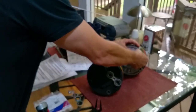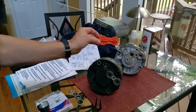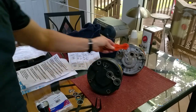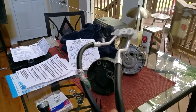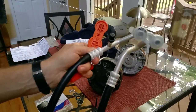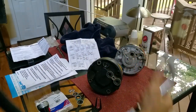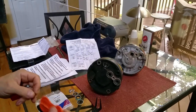Anytime you are about to do air-conditioning component replacements, make sure you keep them sealed until you're ready to actually do the work. Anytime you buy something AC-related — even hoses and whatnot — they usually come with some sort of plastic cover over every port. Keep them sealed until it's time to do the work.